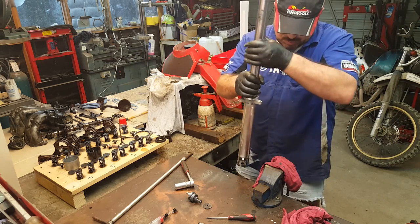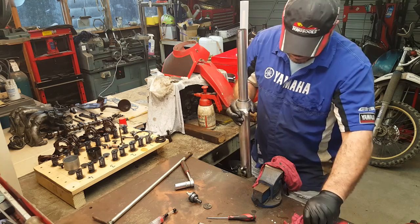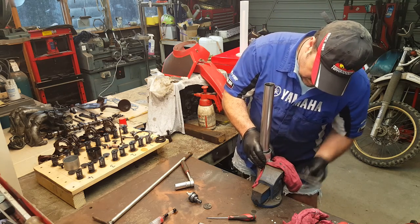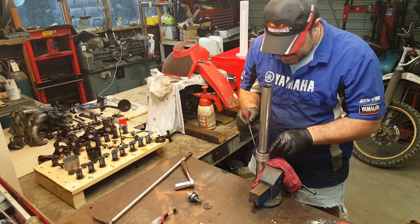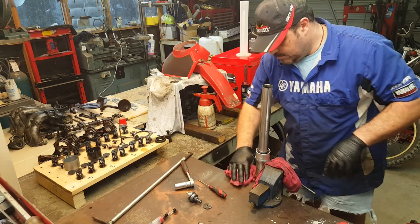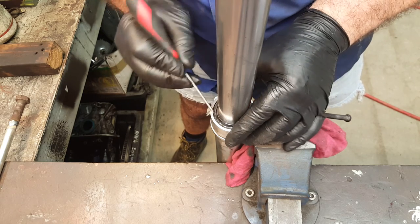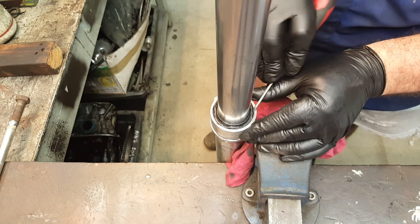The next job — we've removed the bolt at the bottom, it's still dripping oil. We need to clamp it in the vise and remove a circlip from the top. I wonder if I can use that lug there to clamp it in the vise — yeah, that'll work, and it'll drip into the thingy. So at the top here, this is the dust seal we can see — I'm going to remove a circlip. I'm going to bring the camera a lot closer for you. We've got a little circlip to remove — pretty easy to get out, shouldn't take a lot of hassle. We're going to be replacing this when it comes to the rebuild. There we go, that's the old one out.